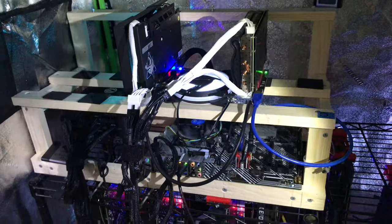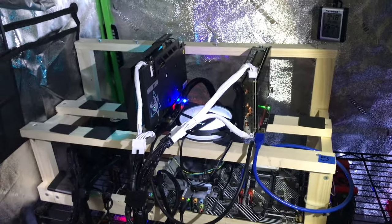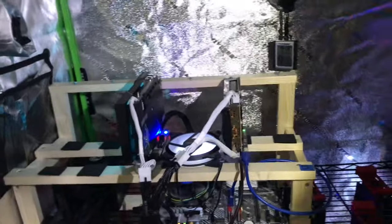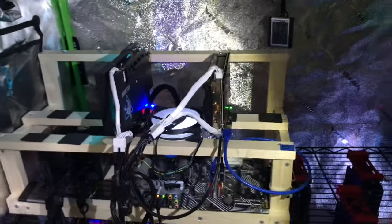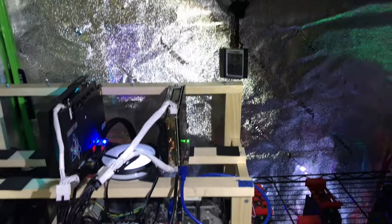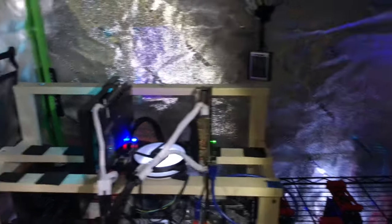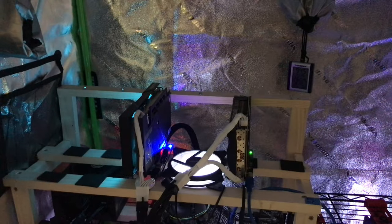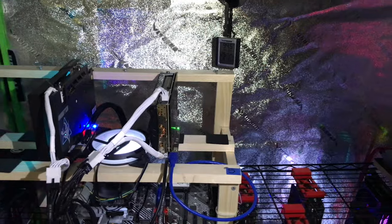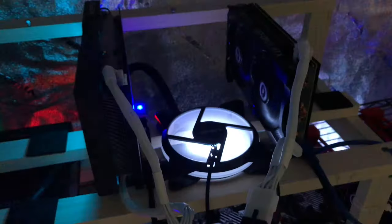Here's my little wood frame — slapped together for $14. There's a video on that, painless, anybody can do it. I'm waiting for some 6600 GPUs — the Hellhound version. People don't like the 6600s but I like them because they don't use much power and they produce the same amount of hash as 1660 Supers that use maybe 30 more watts. These are about 50–60 watts versus 80 watts.